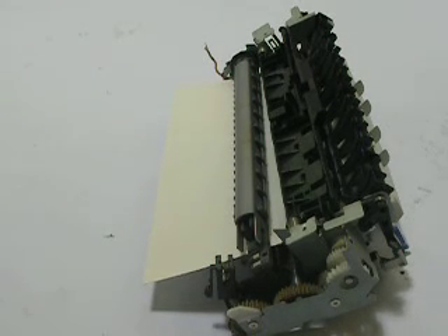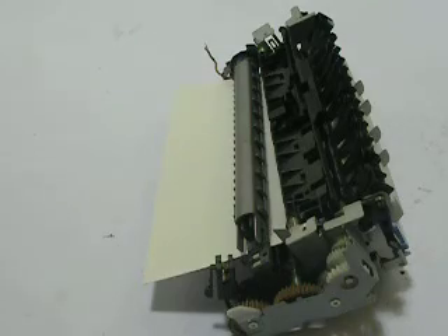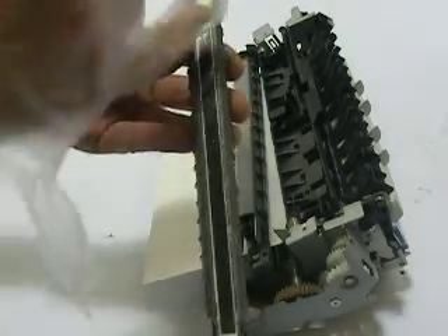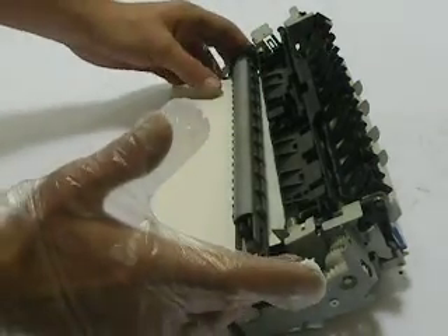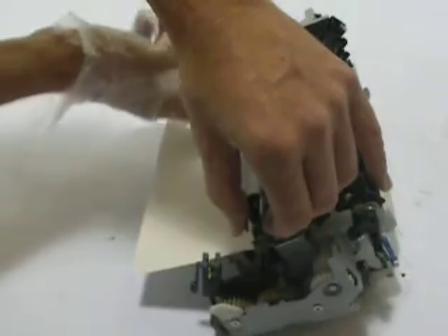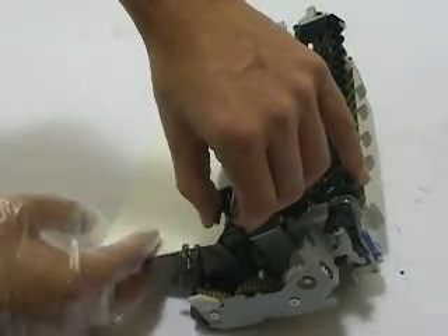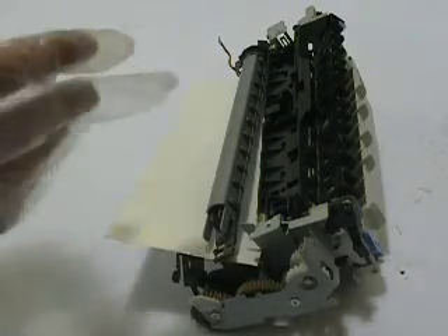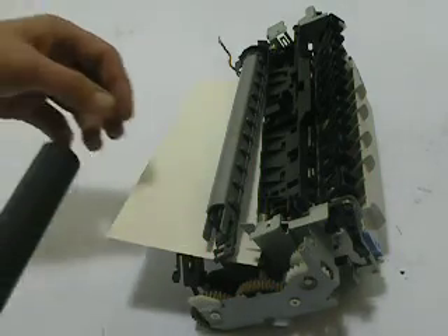At this point we're going to lubricate the element. I use a glove, and we're using a good quality lubricant. What we're going to do is pick up the element and coat the glass at the bottom — not so much worried about the top side, but the bottom is what we want. I'm going to pick up on the left side and run my hand down across the bottom, just like that, getting it nice and good all across that glass. The key here is the quality lubricant we provide with the sleeve — without using this lubricant, you just won't get the life out of these fusing assemblies.